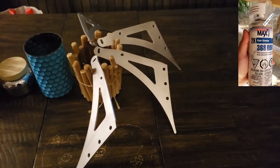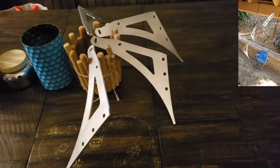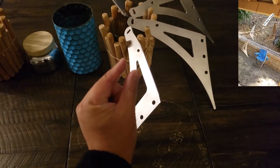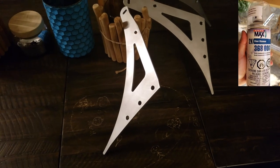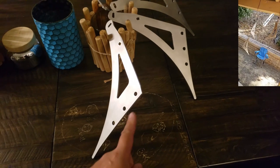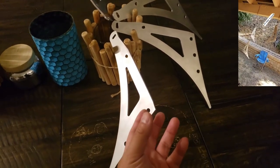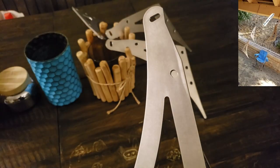It's fairly cool. But at this stage, when I can touch it and do this, it won't scratch it. But next morning, so I would say 18 hours, just hung on the hook outside, dry air. So I will wait 18 hours minimum, at least, before you grab it and touch it. If you put that many coats, it's pretty thick, but now I believe the coat has dried and cured, and it got a lot thinner after it's dried. So 18 hours, and I'm going to wait another 24 hours before I mount this on the car, because of the screws. I don't want to damage the clear coat too much when it's still kind of soft. But it is 2K, so the hardener in there will accelerate to a super hard finish. And it is really cool.